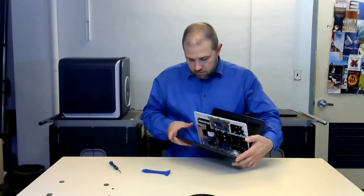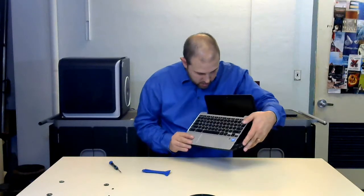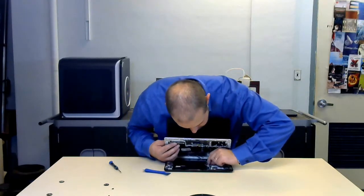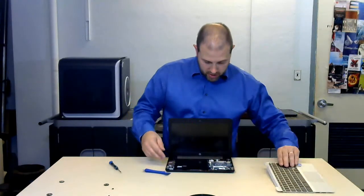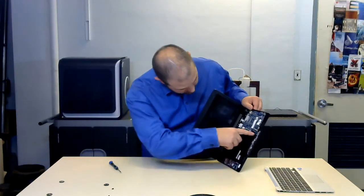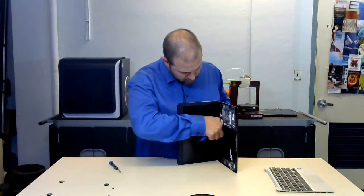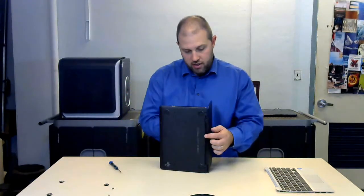The battery in this one is mounted by three mount points, and for the sake of this disassembly I'm going to pop these up and pull them out. Keyboard's out — definitely a plus on that. Looking at the inside, it looks like there's a connection over here. The battery is big and square in the center with three mount points, and it looks like the mount point in the back right here also secures the battery as a fourth mount point. I think this battery is quite secure.